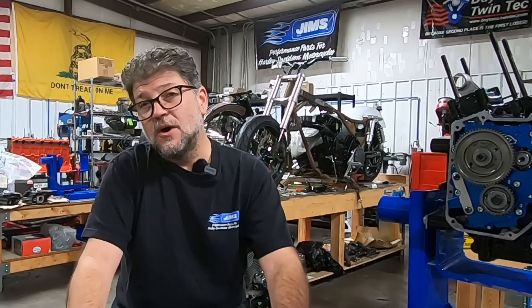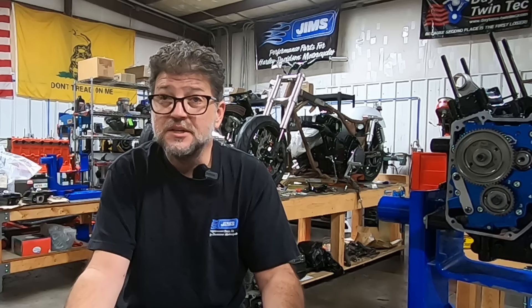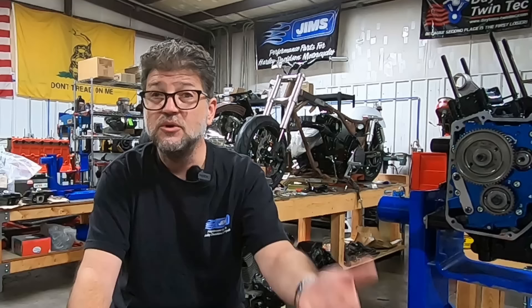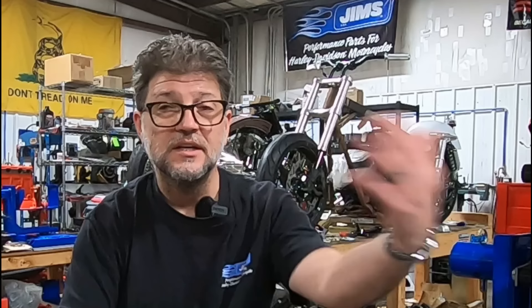This new engine brought out brand new owners, and with the success of all the biker build-off shows, the Twin Cam was off to a great start. There are many good things to say about the early Twin Cam models. Overall, the primaries and clutches were great. Compensators were solid and reliable. The five-speed transmission was near bulletproof. At 2006 and earlier, crankshafts kept strong square-top connecting rods. The Delphi fuel injection was rock solid and reliable. The bike overall was easier to maintain, and common oil leaks were a thing of the past. The aftermarket absolutely exploded with parts, accessories, and performance goodies.